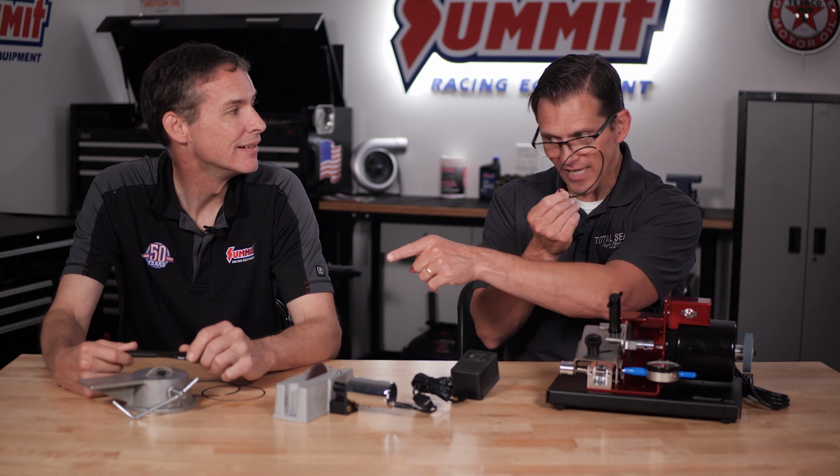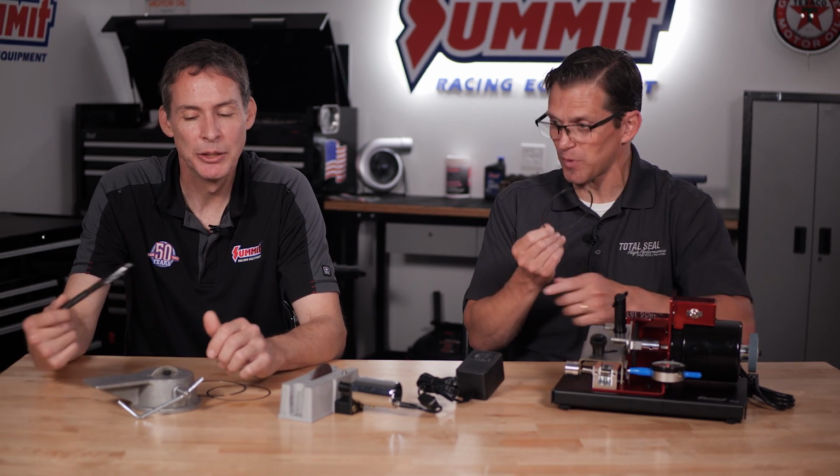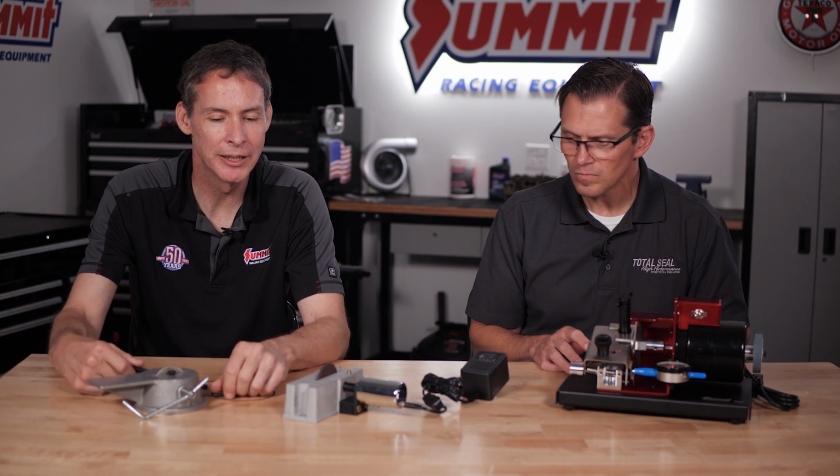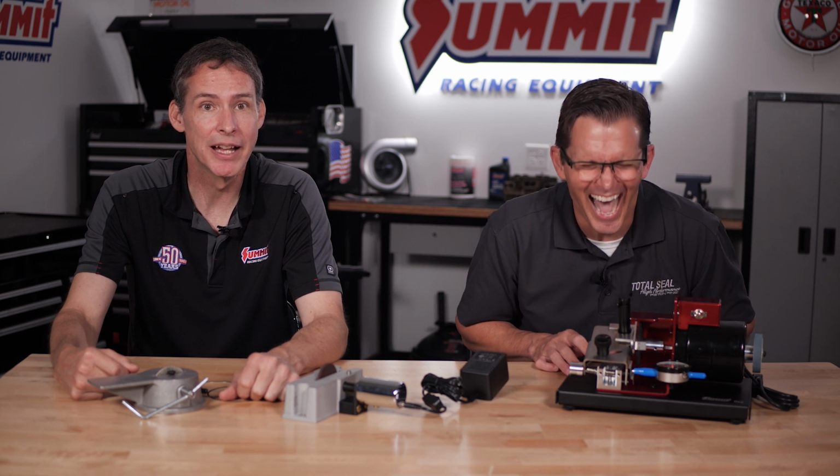The other thing too is that today's steel rings are hard. You don't want to even attempt to grind one of these by hand. You'll be there for 30 minutes grinding and grinding away, and then you have to go back and put it in the bore, and you're in there with your feeler gauges, and you're like, I've been here for 5 minutes and I've opened it up 1.5 thou, and I've got another 10 thou to go. Right. Not at all good.